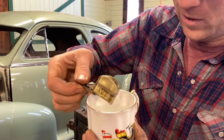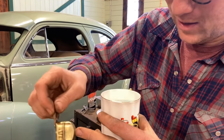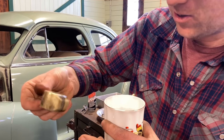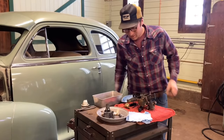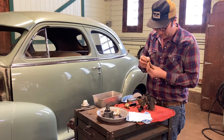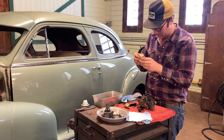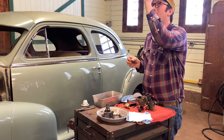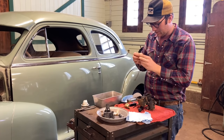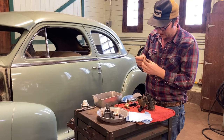And if you do have a hole, usually it's like a little pinhole, and you can just poke through it with a pin or something just to enlarge the hole. And since it's brass, you just solder it up and carry on. Another tip, or good practice, is to check that the jet, of whatever capacity it's for, isn't plugged. If you look up to the light and can see light through it in a clear circle, you're good. And if not, well, you've got to clean it.